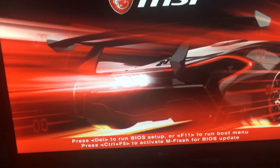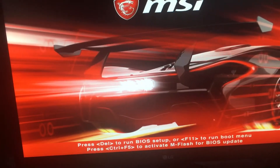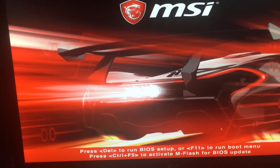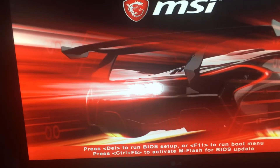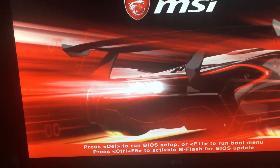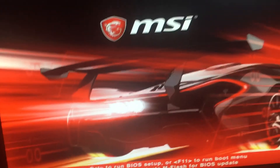The crappy part about using a Ryzen is that if the overclock wasn't accepted, you get the black screen of death and you have to take out the little battery on the motherboard — that will automatically reset it. Take it out, leave it on top of your computer for about five to ten minutes, then put it back in and it'll do a complete reset. Just make sure you don't boot it first. Essentially, that's all you have to do.